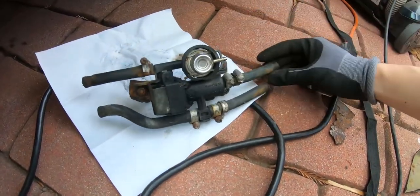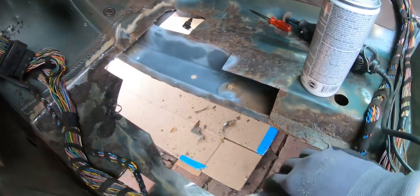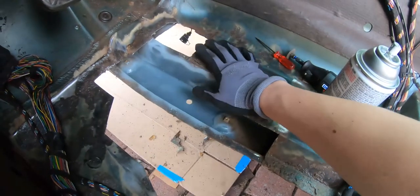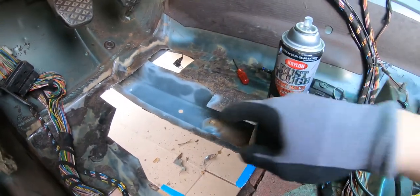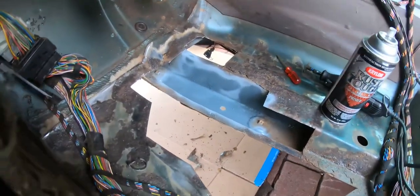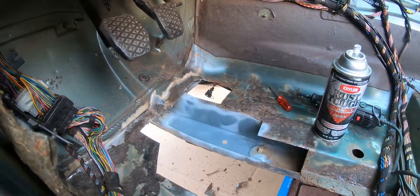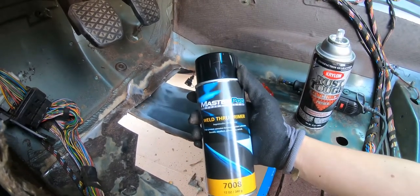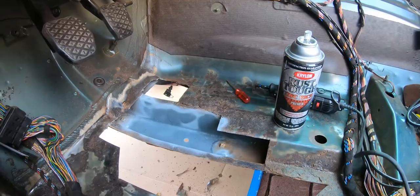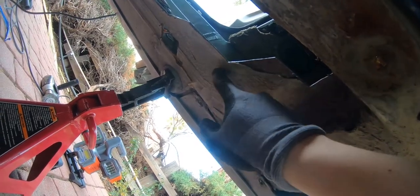I got all of this out. I'm gonna be replacing these fuel lines — these rubber hoses — and new hose clamps. I've pretty much gotten all the bad parts cut out into the shape that I want, and I've also sprayed some anti-rust primer on the inside of the frame rail. Before I start welding, I'm gonna clean up some of the areas where this primer is, grind that down to bare metal, and then spray weld-through primer instead on the parts where welding will be nearby. Before I can start that, I need to peel off and use the wire wheel to get rid of the undercoating around the area that's gonna be welded.